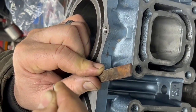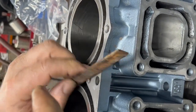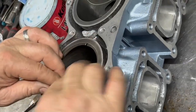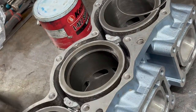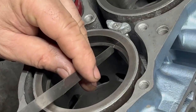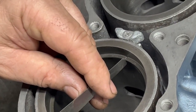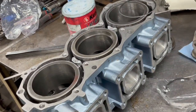This one's pretty tight so I'm going to go for quite a bit here. We'll double-check it — put it back in, push the piston down, and check our gap. That one's really really close to 12 right now, so I'm going to go ahead and open it up just a little bit more — I'm going to go ahead and make it a 12.